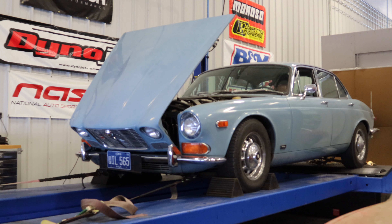Here's all the parts that I'm going to be doing today. I have some new high tension leads, a rotor, contact set, distributor cap, and spark plugs. Although every part of this ignition system is vital and won't work without the others, I'm going to start from the inside out — install the contact set in the distributor first, then upgrade from there all the way out to the spark plugs.